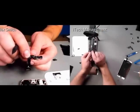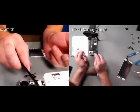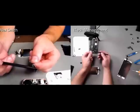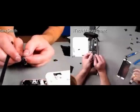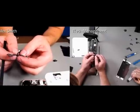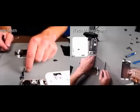And so we have the cable right here that has an integrated microphone, proximity sensor, ambient light sensor, and then a whopping 5 megapixel camera right here, where I remember when I was younger buying a 3.3 megapixel camera, and it was the size of a brick. So it's crazy that this is now a 5 megapixel camera. It took 4 AAA batteries, and it lasted about 15 to 20 photos, with a 4 megabyte memory card that probably cost more than this entire wire assembly.